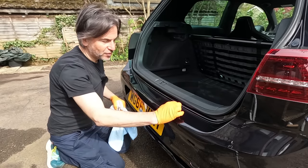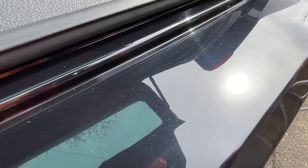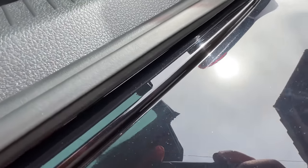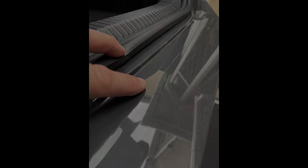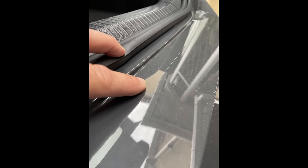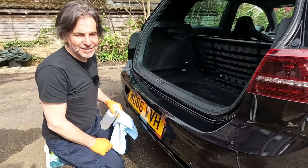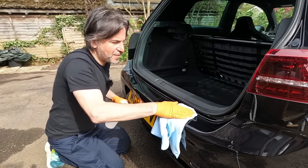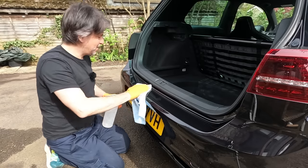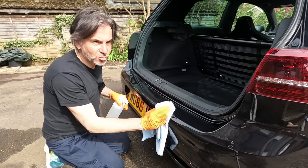I've just noticed an area on the bumper where the tailgate has been rubbing and it's put a very minor abrasion into the paint. This isn't because the car has been in an accident — it's very common on Golfs. I actually saw a brand new Mark 8 fresh out of the dealer where the same thing can happen. The bigger problem is it can rub paint off the tailgate and that can corrode, so keep an eye on that. I'm not sure adding PPF will help since it's around 150 microns thick, which could make the rubbing worse.